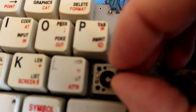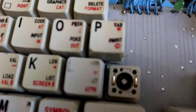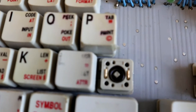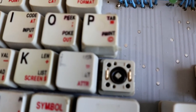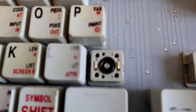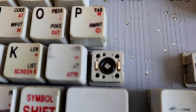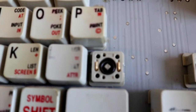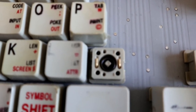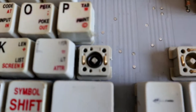Yeah, so there's spring in the cap, plunger, spring in the base. I think we go ahead, we pull all the keys, and we clean everything with a bit of IPA. So there's two things I can do here to lubricate it. Might make them run a bit smoother, but then when you start adding lubrication, any light oil or anything like that, then you run the risk of attracting dirt, and that can actually create the problem that you're trying to resolve. So I think the best thing to do is just to make sure everything's clean with a bit of IPA and see if the keyboard works any better after that. Let's do that.